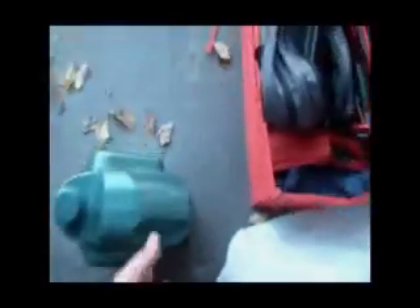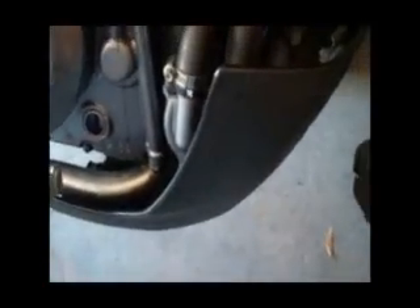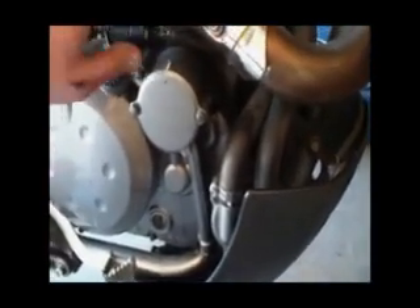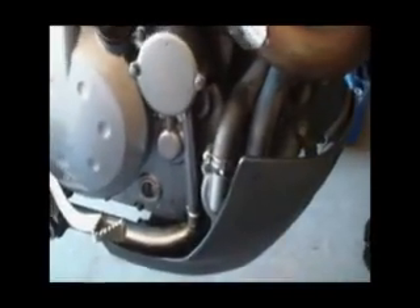Now you can fill it up with oil. Always remember when filling — your bike has to stand on even ground and it has to be upright. There's your oil window and I'm quickly going to fill it. I've filled it up to the top mark in the window. Then we need to start the motor so the oil can get pumped through the filter and all the pipes. And then you can just top it up to the correct level.